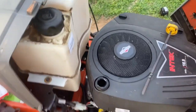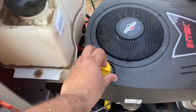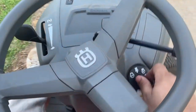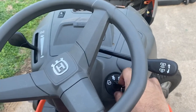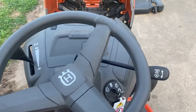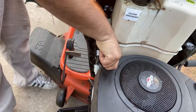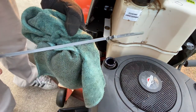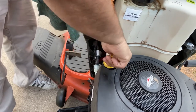After you're done, you want to take off the funnel, put your dipstick back in, make sure it's locked in. I'm going to start it up. After you let it run for about 20-30 seconds for the oil to get into everything, into the filter and all that, turn it off, get your dipstick, check your oil levels. We're at a good level right there. It's a little bit over but the motor was just on, so we're good to go.